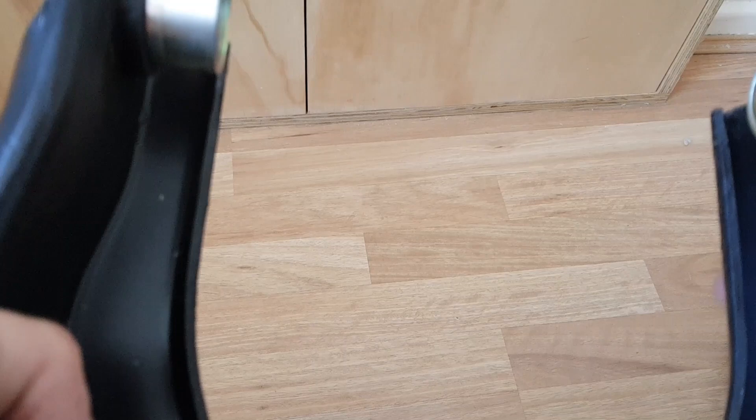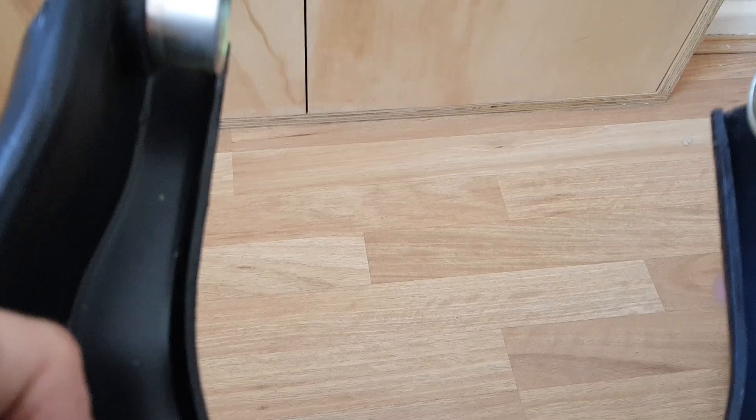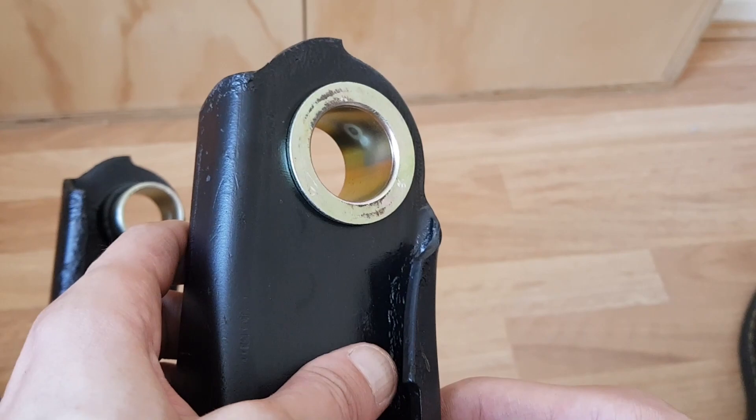The first welds didn't penetrate the steel sleeve at all - when I knock them off there's nothing to show on there. When I whacked the power up on the welder, that's the first time I actually got any penetration - you can see it coming through on this side. There's heat penetration there. Although it's still not the best, it will do the trick. It seems solid compared to the other ones. My first foray into welding, so forgive me.